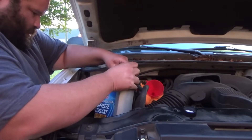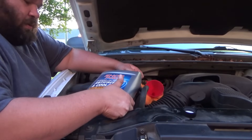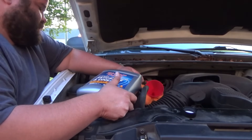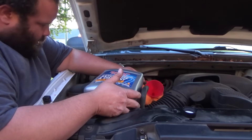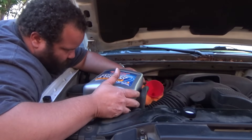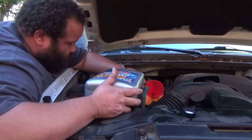For coolant we are putting in some Dex coolant. We already put a gallon of this and it's taking it all the way down. I think that radiator is empty - I'm probably gonna need three or four of these. It's already showing that it's full but I haven't run the engine yet, so once I run the engine I'm gonna have to let it heat up, let the thermostat open up, let the fluid circulate through, and hopefully get all the air bled out of the system.